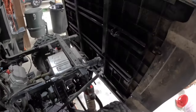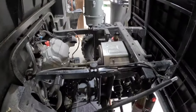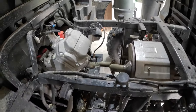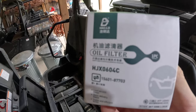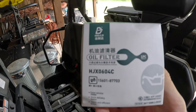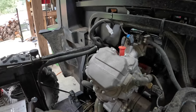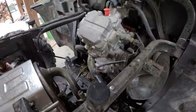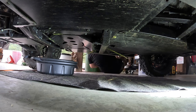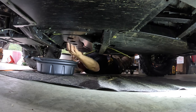Make things easier on yourself, which I've already done. Disconnect this piece right here — that's what's sitting up here on the dashboard, that little bushing. I'll show you how to put that back on, but very simple. We've got to find our oil filter. This is a weird little engine, by the way. I had some folks ask me what kind of oil filter it takes. I actually got it from the Bighorn dealer, Sun Industries I think they're called. Here it is, it's hiding — same color as the engine, so that'll be super easy to get to. Oil filter, really easy. The drain plug's going to be in the bottom, super easy. This shouldn't take very long at all.